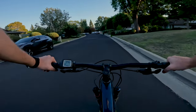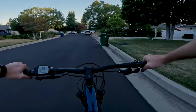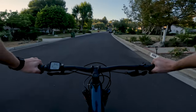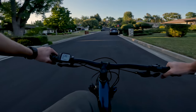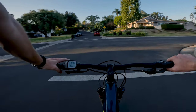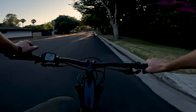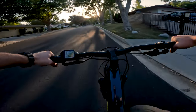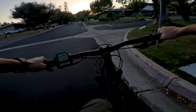It really helps if you have a hill to do this on, because trying to do this on flat ground can be quite tiring. Then what you're going to want to do is get up to a sprinting speed — about 15 to 20 miles an hour. During this whole process, make sure the wheel you're bedding in doesn't lock up. Get up to about 20, slow down to walking speed, back up to about 20, down to walking speed — and you want to do this five times.